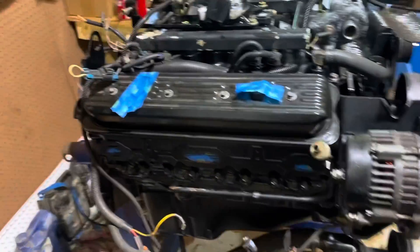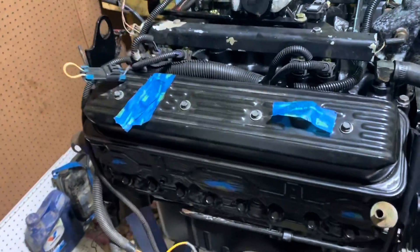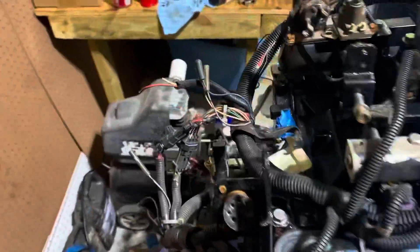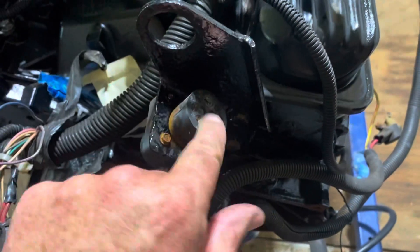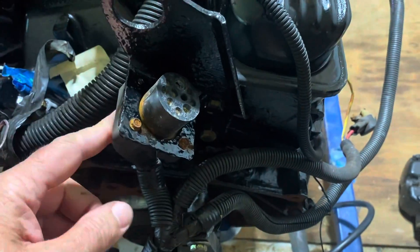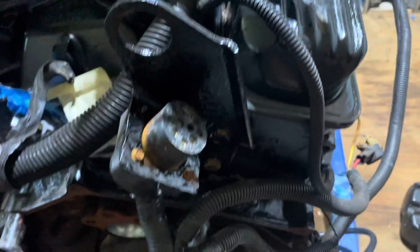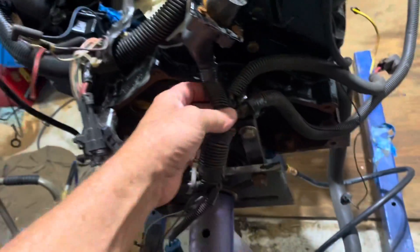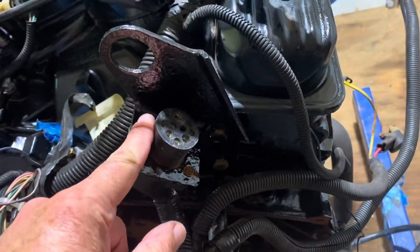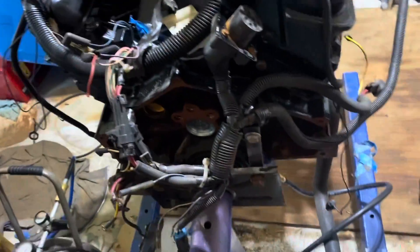I'm now putting on the harness and I'm able to do this because of my knowledge of fuel injection. I started with a common starting point, which is this bracket here — this is your boat-to-engine harness interface connector. I first mounted this bracket on the back of the cylinder head. By the way, it's powder coated — it was all rusted up, I cleaned it up and powder coated it. Then I got to your connector here and identified what's what from the big mess of wires.